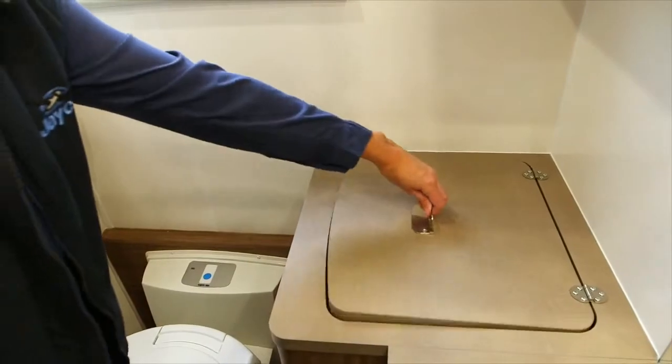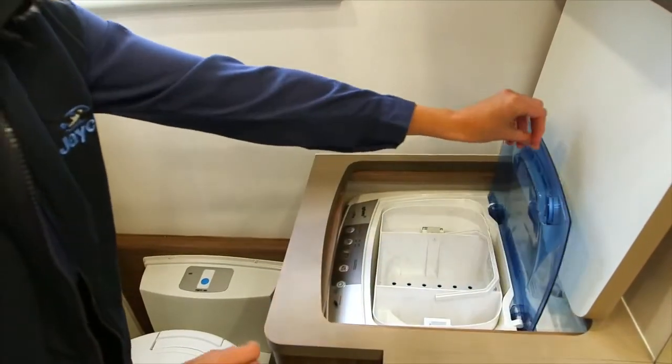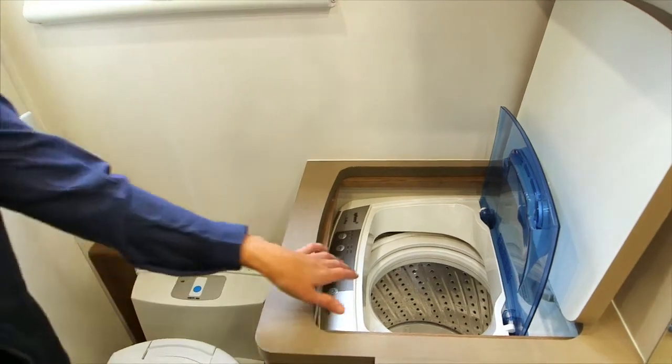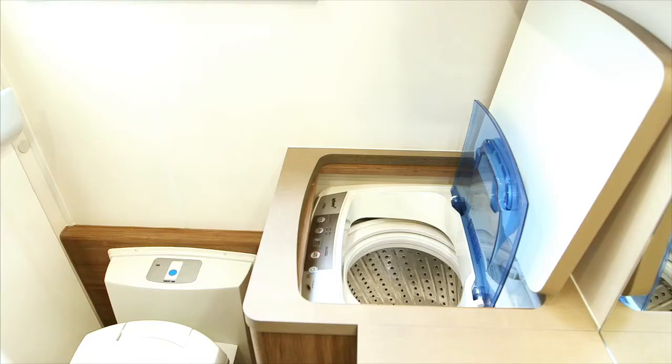The Sphere 3 kg washing machine has 5 processes, from a wash-rinse-spin cycle lasting approximately 38 minutes to a simple spin cycle lasting approximately 7 minutes. Wash settings are set via the control panel. To wash clothes, select the proper water level according to the quantity of clothes. Select the programs and process. Close the lid and press the Start/Pause button. For more information, refer to your washing machine operation manual.